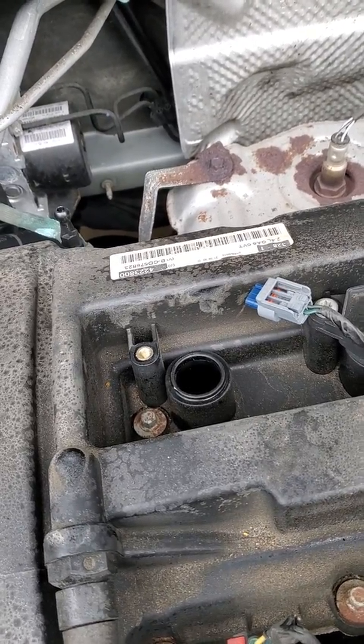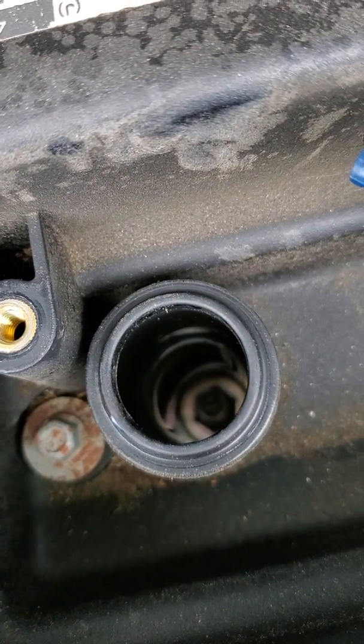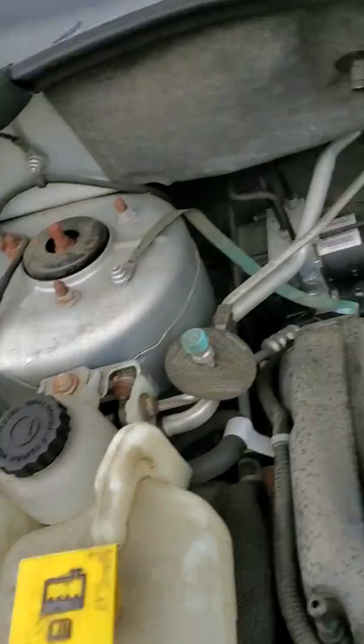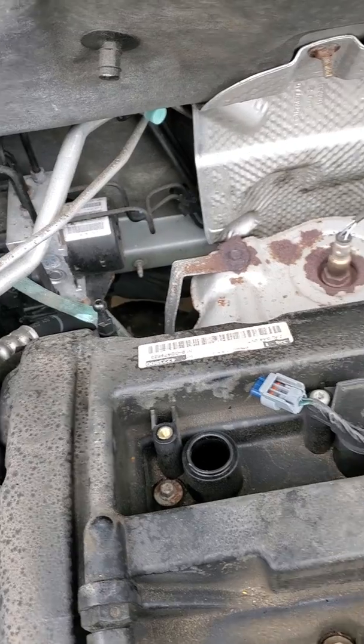We're not talking about oil getting inside the cylinder. We're talking about it getting in the spark well tube where the spark plug is located, and you can see the spark plug is down there inside the tube. If the seal leaks, then we're going to fill that tube up with oil, and what that oil will do is actually start to weaken or soften the rubber on the boot on the coil. Likewise, we might run into a misfire condition on that. So anytime that happens, we want to make sure that we are not just replacing a boot because it got soft and spongy from sitting in the oil. We want to make sure we correct that problem as well. So we would have to replace that seal underneath there, as well as replace the boot if it's serviceable.